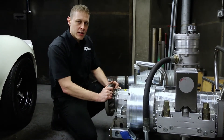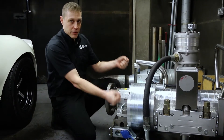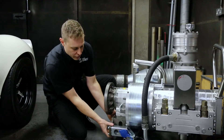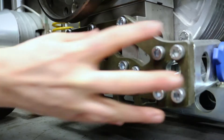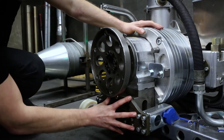The whole time that we're controlling the speed of the axle, we are also measuring the amount of twisting force that's coming out of the axle. That's done by this whole pump assembly being able to leverage itself onto a deformable strain gauge down here, which we calibrate at the beginning of every week with dead weights. The more this strain gauge bends, the more twisting force is being applied by the vehicle's axle.